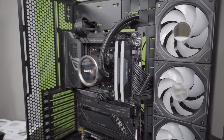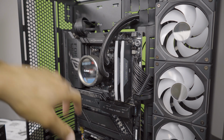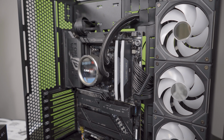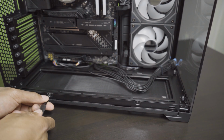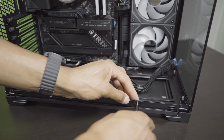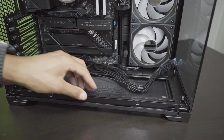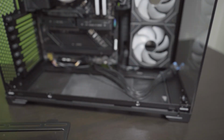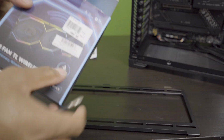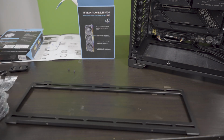We are almost done. I need to install my fans now, my other fans. So two fans are gonna go right here and 3 more fans are gonna go at the bottom. Once again, these are the reverse blade. Since I'm installing it on the bottom, it's going to be intaking air up. So these need to be reversed, and the ones on the back are going to be exhaust, so they're regular blades. Just a point of the day where I'm just trying to get through this, so I apologize if I'm starting to move kind of fast.